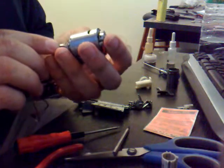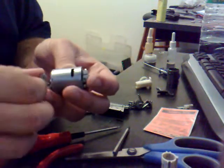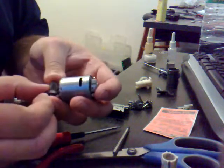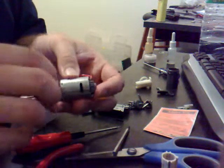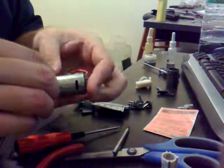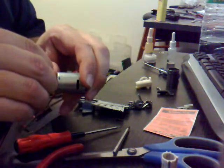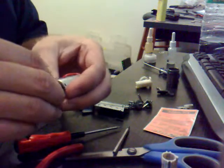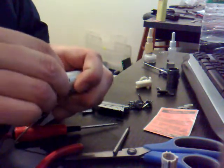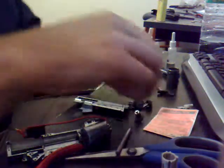Just tighten it slightly on the motor height, just so it's in line. We need to make sure that when it's spinning, it's not too tight on the motor. I think we can just do a tiny small shim on there. Look, it comes as standard with quite a large one, but obviously once you change to bearings, that could be an issue.